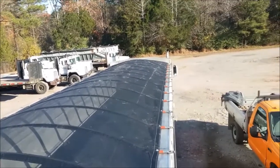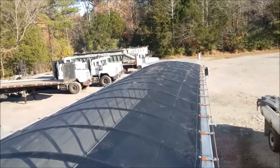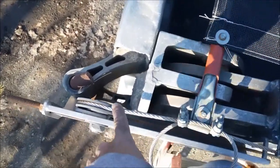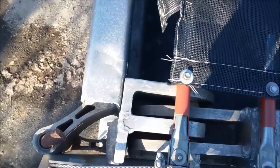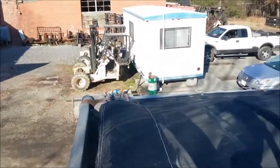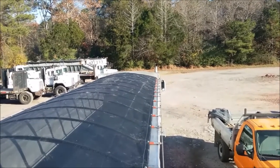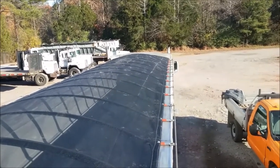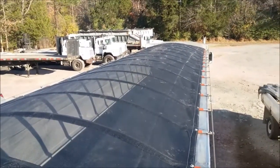There's our final reinstalled tarp — all the bow clips and easy clips secured down the passenger side, everything secured on the driver's side, nice and square at the rear of the trailer. We've brought it back as close as we can to the pulley wheel — about five to six inches between the top of the pulley wheel and the center of the last bow. Good installation, works well. Please feel free to call me if you have any questions at 757-615-4379, and I'll have all my contact information at the end of this video as well. Thanks for watching, take care.